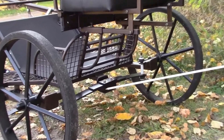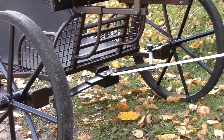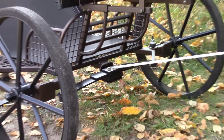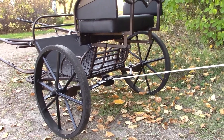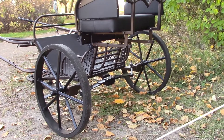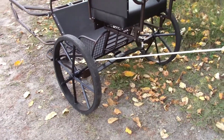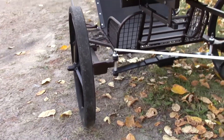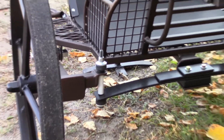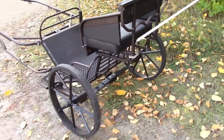You can remove this spacer and that will raise the cart one inch. You can also take the spring package and put it underneath the mount as opposed to above the mount — that will raise the cart two inches. You can also move the spacer under the mount in between the mount and the spring package, and that will raise the cart three inches. So the cart can go one, two, or three inches taller than it is now. You can also run these lock nuts up on the suspension bolts to the top, and that will lower the cart a further three-quarters of an inch. So there's lots of height adjustment for how you feel comfortable driving.